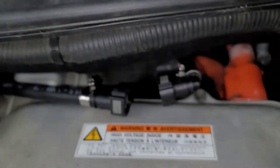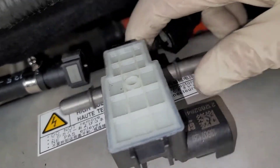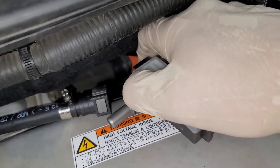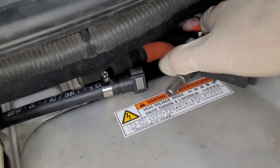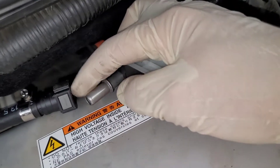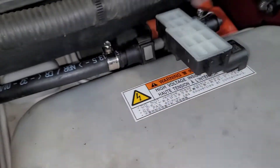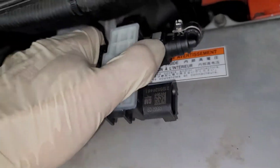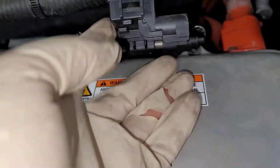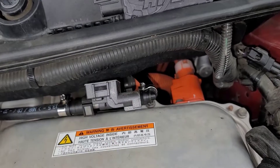Now they're going to be facing each other. We're going to plug in the flex fuel sensor here. If you want, you can spray some WD-40 on this to make it go in easier if it's not working very well — it's got an O-ring so it'll help the O-ring slide. There we go. I'm going to zip tie this so it tucks away and doesn't touch the cover right there — just criss-cross the zip ties.